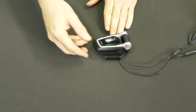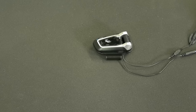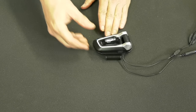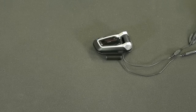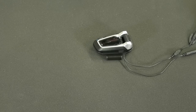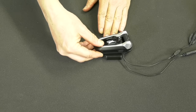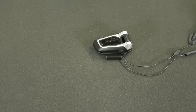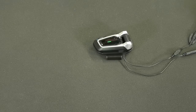You can also use buttons to control radio. To access radio via buttons, double-tap the media button. Press once to move to the next station, or twice to move back to the previous one. Perform auto scan by pressing and scrolling the roller button. Press the media button once to stop the auto scan process, and press it again to save the station. You can also toggle between radio and music by pressing the media button for two seconds, or until you hear the second beep.